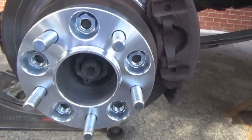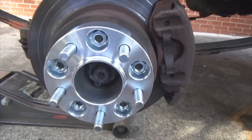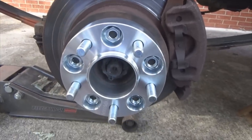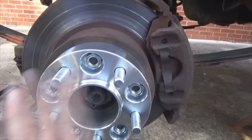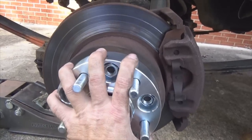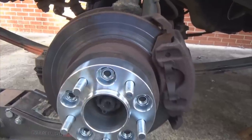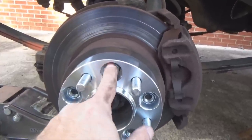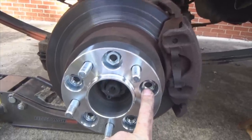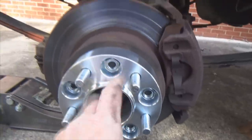Okay, at the risk of sounding like I'm totally over repeating myself, I want to re-emphasize this again. When using the wheel adapters, or heck, even just putting on aftermarket wheels or even steel wheels, torque your lug patterns, people, seriously. Any of your aluminum mag wheels, stuff like that, on your Chrysler, your Jeeps, whatever, on the half inch 20 bolt patterns, half inch 20 is your thread, and you got a 4.5 inch bolt pattern, you should be right about the ballpark of 100 pounds. 85 to 110, but I like 100 pounds because, hey, it's just easy to remember.